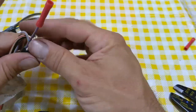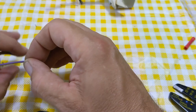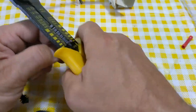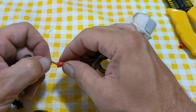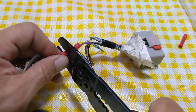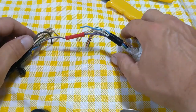Make sure it's on. Now we're going to go to the wires from the whole wiring harness and look for the same colored wire. In this case it was the purple wire - this one here. Peel back the other ones and strip that wire, push it on making sure it's all the way in, then crimp that down, make sure it's tight. Just do that for all the others, making sure you go same color to same color. That's how I did the cable itself - real simple.